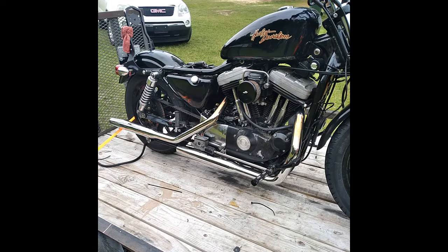A couple of things I didn't go over in the video that I need to reiterate. When you do the contacts on the starter, it's a piece of copper going through a piece of metal and there's two insulators in there. There's an insulator that goes up through the case that the stud for the contacts goes through, and a little plastic piece that centers it, then a bakelite washer on top, then the nut. When you're tightening those studs down, don't overtighten them. You want them tight, but if you crack that insulator, you've got to go buy a new kit.